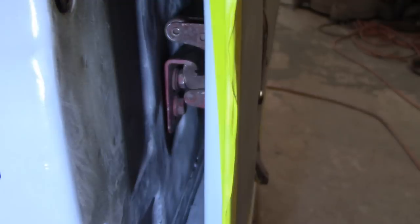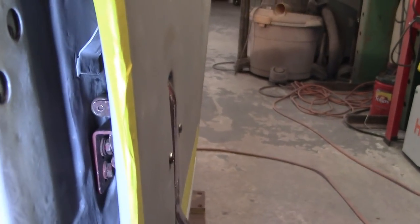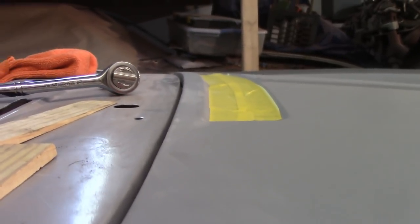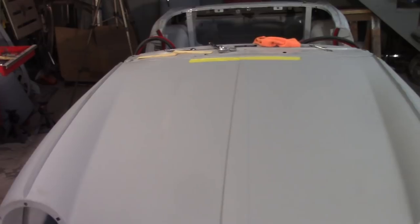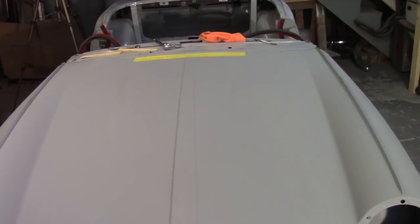One of the comments from the guys on the forum — let me grab the flashlight. If you look in there, that's the latch mechanism. If I can shim that latch mechanism a little bit, I might be able to push that out, but I'm not sure it's going to work in this direction. Also I've noticed you can see how much the bonnet bows up on the inside towards the center there. The way I see it, that could be either that the bonnet is too squished together and it's causing the center to rise up. That mounting plate is probably right about in here, causing some tension, so that could mean I need to spread it out more to try to get that center to flatten.